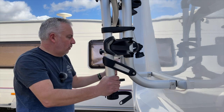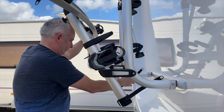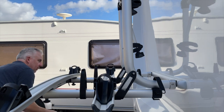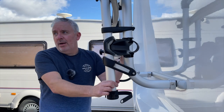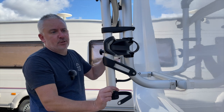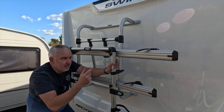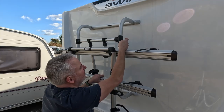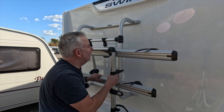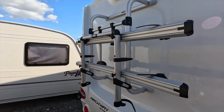I'll show you more about this bike rack in a couple of weeks — we've got a holiday booked and we're taking two bikes with us. I'll video fitting the bikes to it then to see how easy it is. Luckily the bikes are quite light so lifting them up to this height isn't going to be a problem. Let me know in the comments if you've fitted one of these bike racks, especially if you've got a Swift and the brackets are already fitted, and how you got on — was it straightforward, did the instructions help, or do you agree with me the instructions are useless? Just to recap — tools you're going to need: hacksaw, Phillips screwdriver but small, maybe some kind of pliers to get the clips out if they're a bit stubborn, Allen key to tighten up the bolt, and a screwdriver drill to get the self-tapping screw in. I hope that wasn't too boring and I made it look more complicated than it actually is — it's actually really straightforward. But the instructions are pretty awful. I'll see you in the next one. Bye.